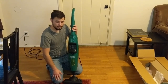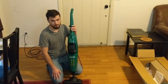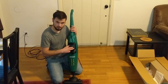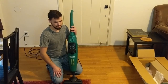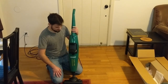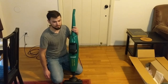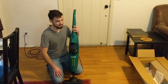The most accurate measurement was probably the water lift — I can't guarantee perfect seals for the CFM airflow readings. I also don't have a way to measure filtration quality, but given it just has a basic exhaust filter, this won't be the best option for allergy sufferers. For a small, affordable commercial vacuum though, this thing is kind of strong — significant water lift, decent airflow, and the nozzles perform pretty decently.